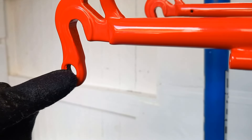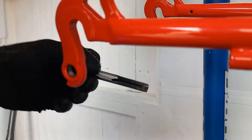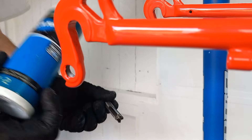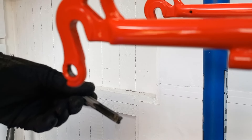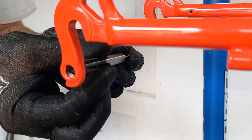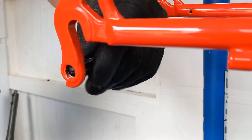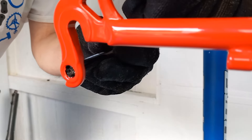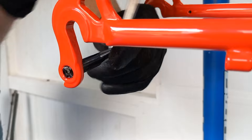You can see there's quite a big build-up of paint just on the first couple of threads. We did have something screwed in there when it got painted, so we need to tap that out. I need a tap and a bit of cutting fluid — I use the Park Tool cutting fluid. I could go through the front, but the back's quite clear so I can actually pick up and feel the threads relatively nicely from the rear. We'll tap this through and hopefully it'll clean it all up really nicely.